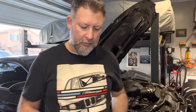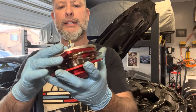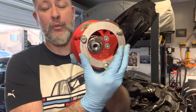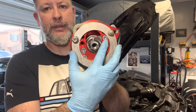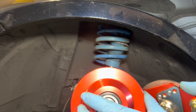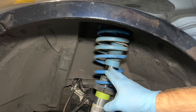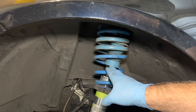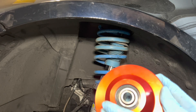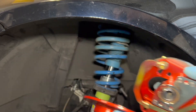Let's look at the features of the Vorslag. While the Dynan was fixed and you can't do anything, the Vorslag is adjustable - you can give it more negative camber or neutral camber. You can also adjust the caster with these bolts here. Another great feature is that you can change out the bottom depending on what type of spring you're running. This has a track base spring but it's still progressive. If I were to upgrade to a true race coilover system I'd need a different bottom piece, but you can keep your top camber plate and just change out the bottom.